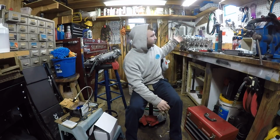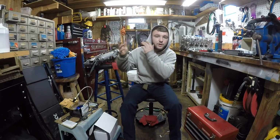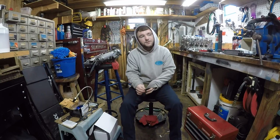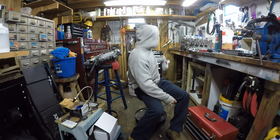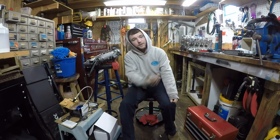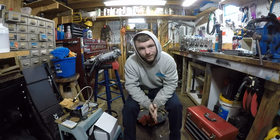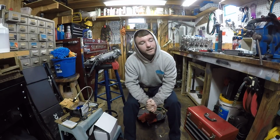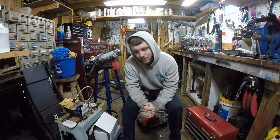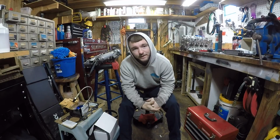You don't have to go in there and take your valve seals out and all that. You don't have to, but this has been sitting for a while, so I went ahead and replaced my valve seals to be on the safe side. I'm going to have to clean up the valves too, which is going to be in another video coming up here soon. Let me clean the valves and hopefully put all this back together and throw it on the block out there so we can drive it. So that's my plan, is to get this done so we can drive it.